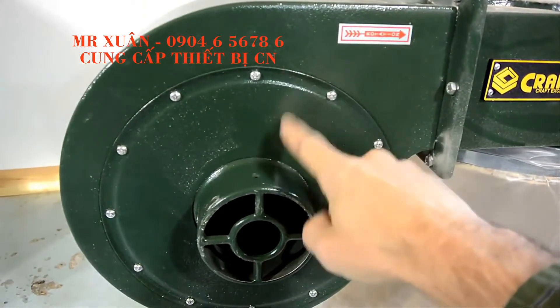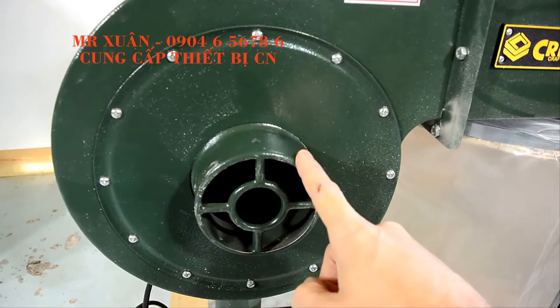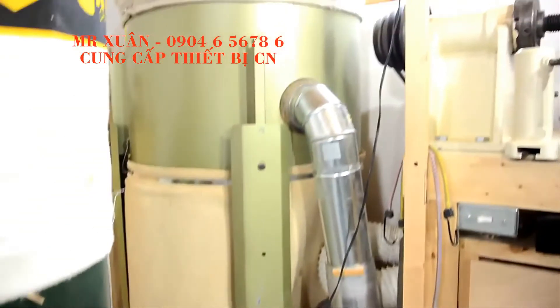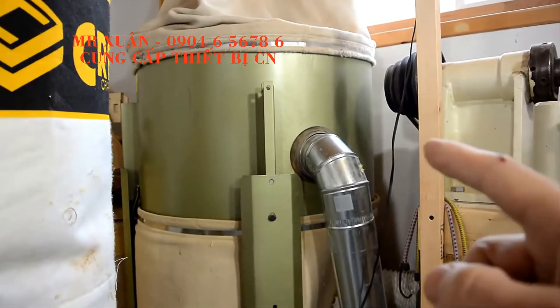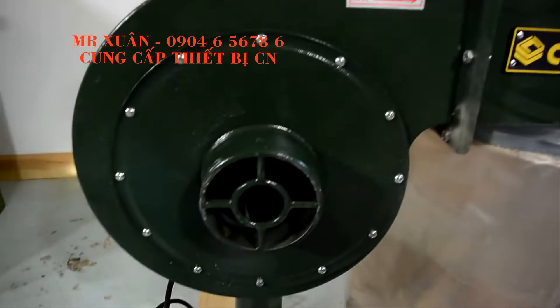The blower's a bit on the small side. I measured the pressure from it, and it only does about 17 centimeters — that's about 6 to 7 inches of head — whereas this one here will do 20 centimeters, or about 8 inches of head, so this one has quite a bit more suction than this one.